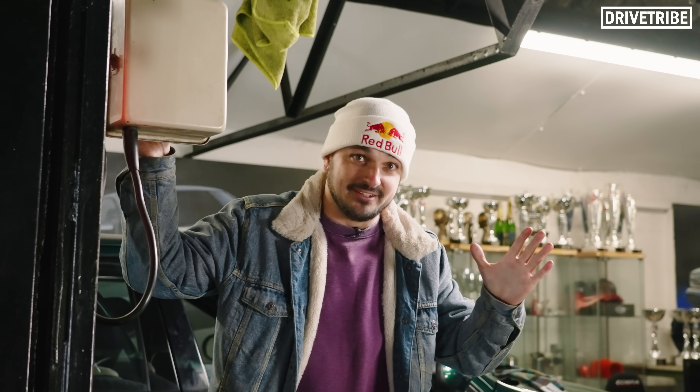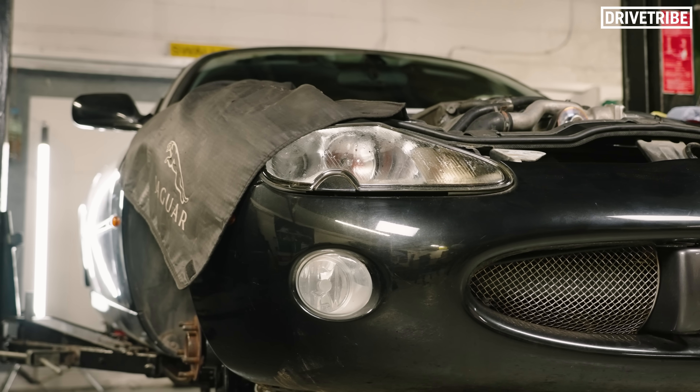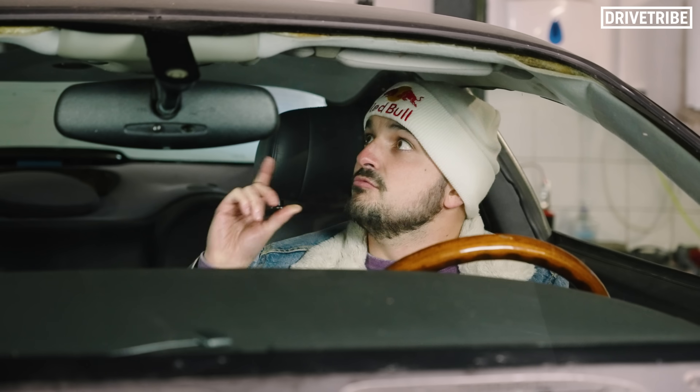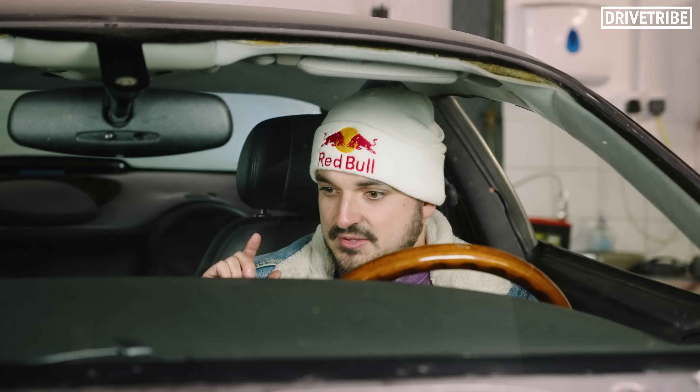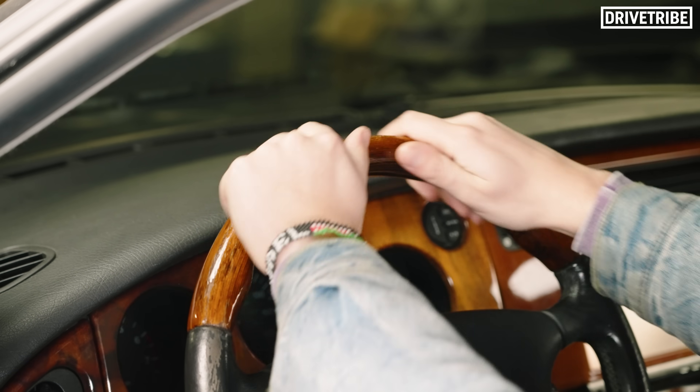So that's the front done, that's the rear done — let's have a chat about the interior. With the mechanical stuff pretty much taken care of on this car, we can turn our attention to the interior. It's pretty good in here but there are some bits of damage. Starting with the roof lining — this happens with pretty much all Jags of this age — it's started to sag, so we'll get that retrimmed. The steering wheel is the first port of call — it's started to splinter and de-lacquer itself and it's quite sharp to the touch, so we definitely need to sort that out.